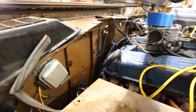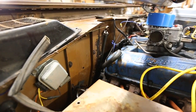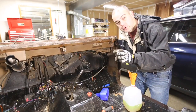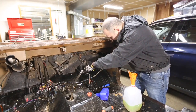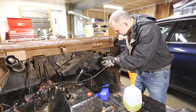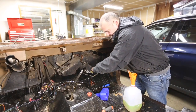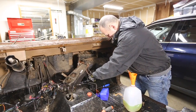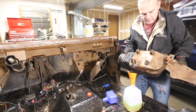For the heater box, I think it's just those four bolts — or nuts, actually, nuts with washers on them. I got the four nuts off and all this wiring is pretty much loose. Keep in mind there's still radiator fluid in the heater core, so after I get the copper fittings out, I'm going to try to keep it angled up so I don't spill any. There's a little mouse habitat in there.